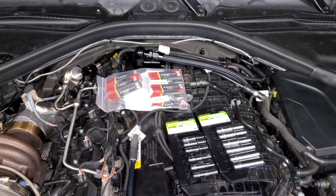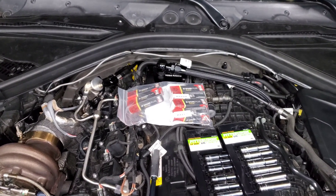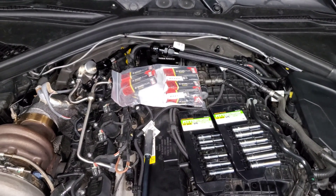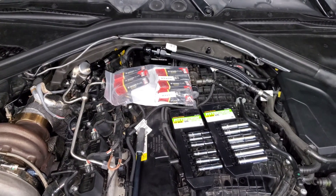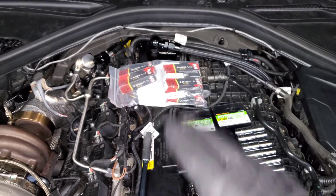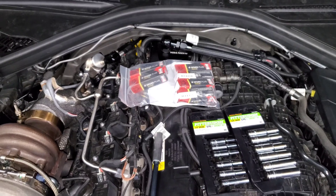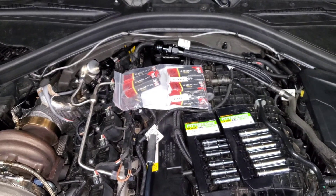Go with the OEM Champions, or if you prefer NGK you can get the NGK versions. If you buy six plugs from the dealership, nine times out of ten they'll give you five of one plug and one of the other because they mix them all up and sell them under the same part number. So it's usually easier to just buy the plugs directly from the manufacturer — FCP Euro or wherever — so you know you're getting six of the same one.